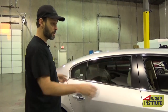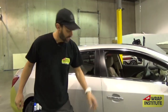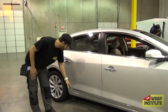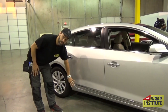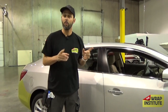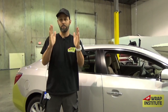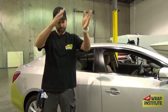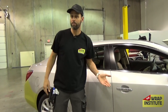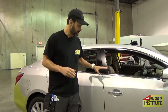Instead of wrapping all these panels, I'm wrapping this passenger side in one, two, three, four, five, six panels plus the running board. The material is 54 inches and doesn't reach the bottom if I go down the other side, so it'll come short. On the other side we'll do patches of scrap material; on this side we'll use black matte, or possibly white scrap from panels where I trimmed off a wide white bleed — that may fit at the bottom and look like part of the wrap.